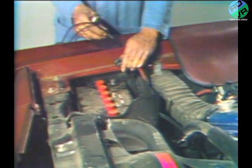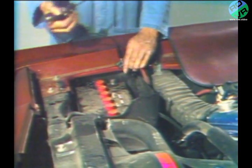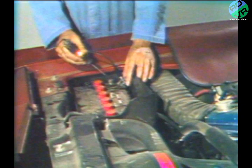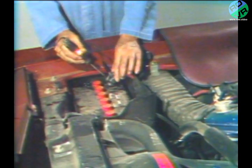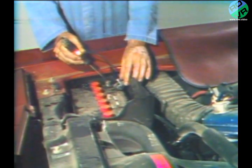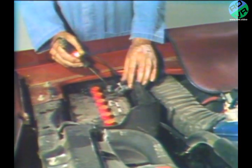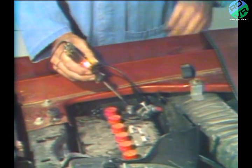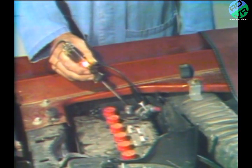As we mentioned, the best way to check for battery drain is to remove the positive battery cable from its battery post and connect a test light between the battery post and cable terminal. This places the light in series with the battery. If the light comes on, reconnect the cable for an instant just in case the clock winding mechanism was causing the current draw. Now any current flow through the light with all electrically powered accessories off indicates a drain on the battery, one that could weaken the battery overnight so that the engine is slow to start in the morning.